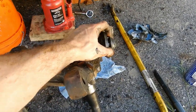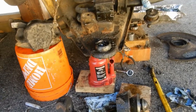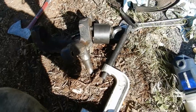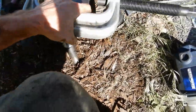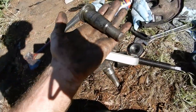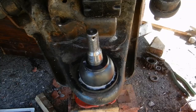This might be the most insane thing I've ever seen — I actually shattered the ball joint. I've got all these little fragments from hitting the knuckle rather than getting it to budge properly. So I'm going to try and press out the bottom half of the ball joint now. Finally, some honest-to-goodness success. I finally got it out by placing the clamp over it, sticking my axle in as a makeshift piece, and using the impact wrench — that finally broke it free. That piece was incredibly stubborn.